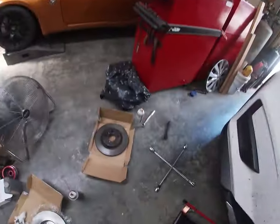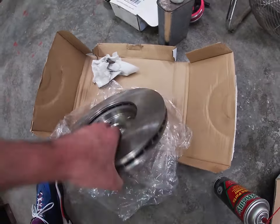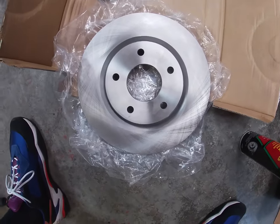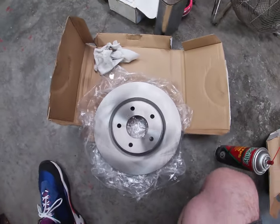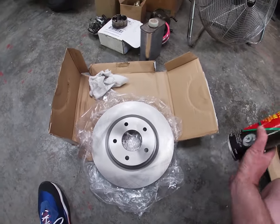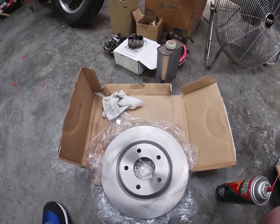If you saw our video a couple weeks ago, I changed pads on my wife's car. I should have gone ahead and changed rotors while I was in there — they looked good and felt fine, but they're warped. We were starting to get a thud when you drive and hit the brakes. We have a brand new Power Stop plain rotor — I didn't get cross-drilled or slotted, didn't need any of that. First thing we did was wipe it down with a little brake cleaner and paper towels to get it clean.